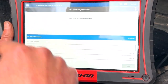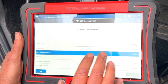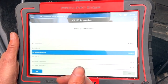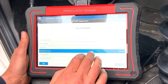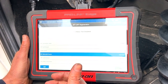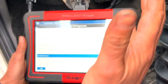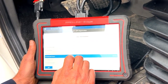We actually put this filter in for this gentleman back in March — a brand-new filter. I was really trying to find a way to avoid having to take it out and clean it, given that it was only about eight months old. But he had some electronic issues and kept running the truck. When you have those issues, you need to get it taken care of immediately, because if the truck isn't doing its regular regens, it's going to keep building up soot to where you'll be forced to take it to somebody who can do what I just did, or you'll have to take it out and clean it. This guy had it someplace where they just wanted to delete it — and I don't recommend that in our day and age.